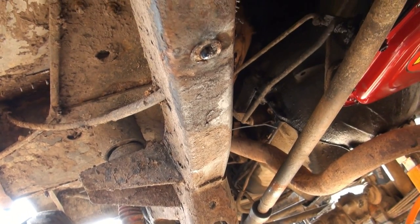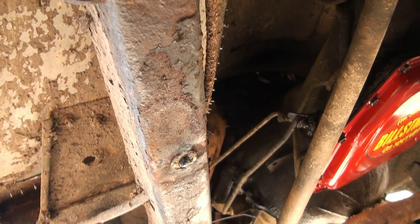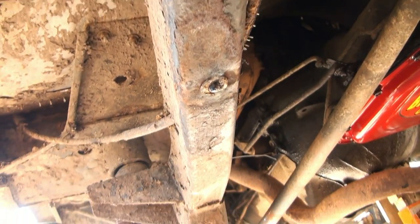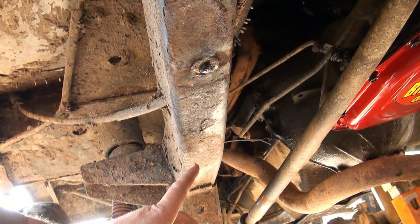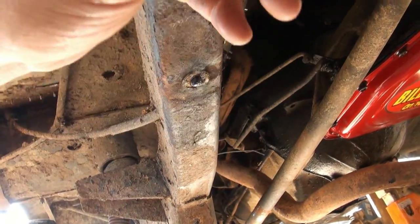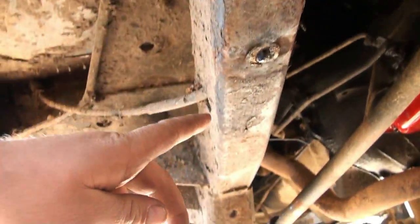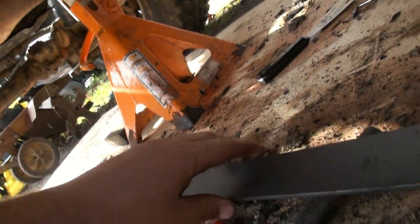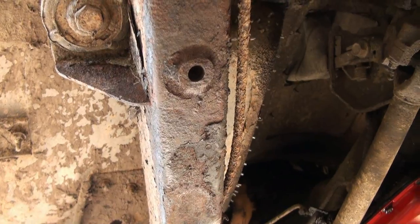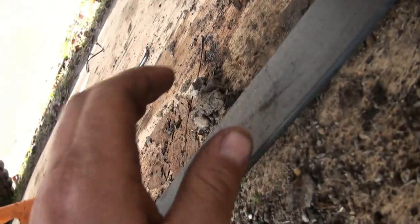Well, tubes, I think I've thought of plan B. I want your opinions on this to see what you think. Oh boy, what I'm gonna think of doing is cutting this whole thing out all the way back, probably to here, and then all the way down, cut that all out. I got a piece of this stuff that I could weld some new nuts on the inside where those should be, and we'll just weld that piece back in.